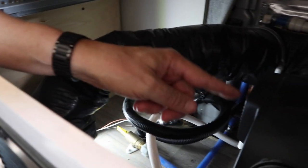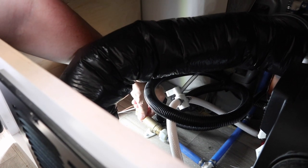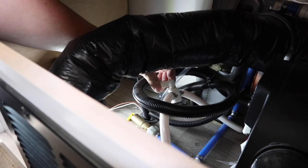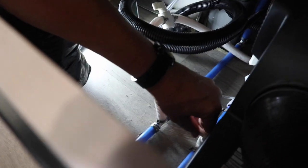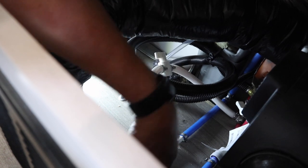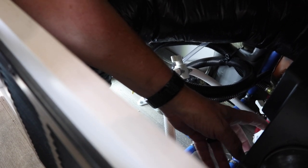The Truma Combi holds 2.6 gallons, so make sure all that's drained. Once it's completely drained, we close this back. That keeps water from coming out here. Then take this white handle and turn it in line with the hose — that opens up the bypass. On the blue line, rotate the handle so it's across the line. On the red one, do the same so it's across the line. Now the water is bypassed — antifreeze comes from the blue line in, can't go into the Truma because that's closed, goes through the white bypass line and back into the red line. So the Truma is bypassed and no antifreeze will go into it.